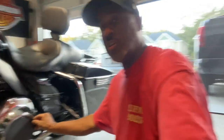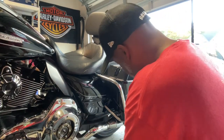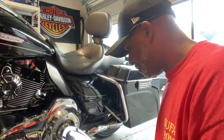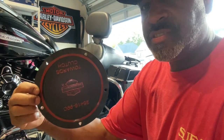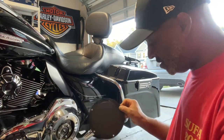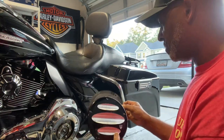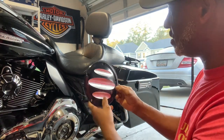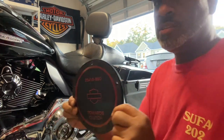One way it goes on: this side faces toward your clutch, this side will be black. Just line this up. So we've got the new derby cover and the gasket. Remember, you want this side facing in, and your cover goes on the opposite side. I'm going to line this up — I want the Arlen Ness emblem reading on the bottom — and spin it around until the holes line up. And boom, holes are lined up.